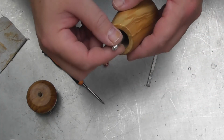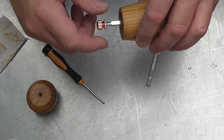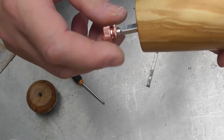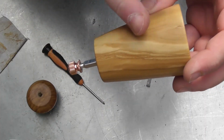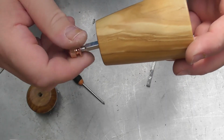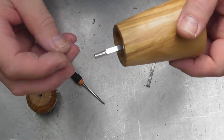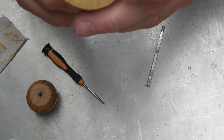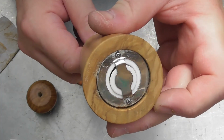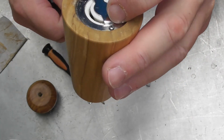The new ones that we've got, these are actually an M5. These are nice and easy, M5 size thread, and you can see that goes on there. And you can also see, in terms of trimming the actual shaft itself, there's actually quite a lot of adjustment available on the knob. They don't look like very big knobs, but normally the adjustment is at least sort of 10 millimeters, whereas the burr at the bottom is probably only moving, I haven't measured it, but I'd guess probably 4 or 5 millimeters at the most, something like that.